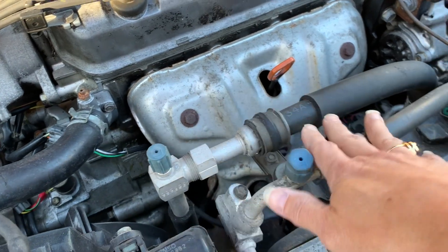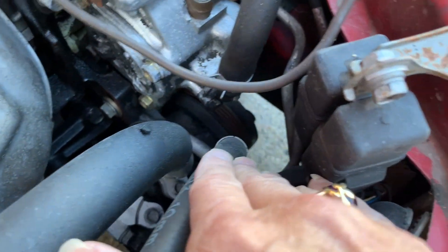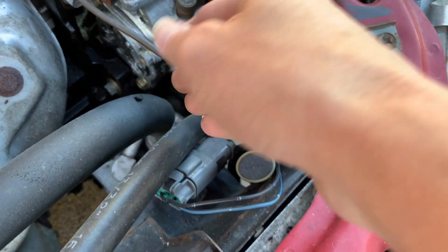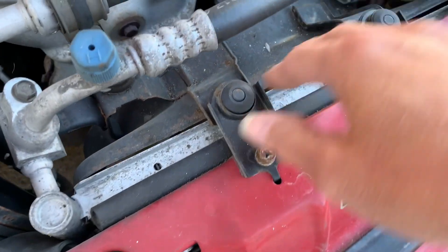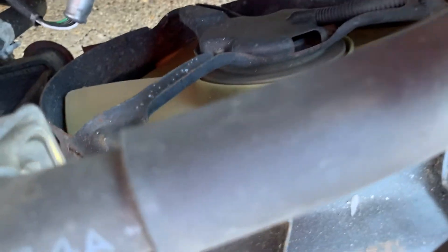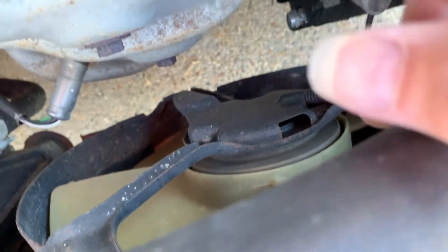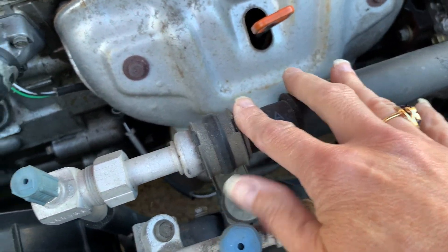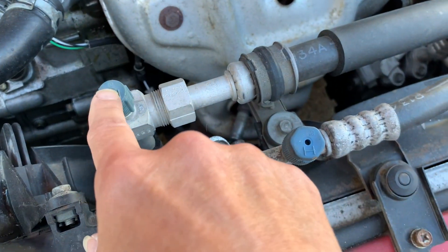These hoses here are for your air conditioner. Down here is the compressor where the hose is hooked to. All of this is the AC compressor. It has a belt that turns the compressor and pumps the R134A coolant through these tubes into the condenser. The condenser looks a lot like a radiator. And this is the condenser fan. There's a high and a low port — the high pressure is a smaller hose, low pressure is the larger hose. This is where you would add your R134A refrigerant if you needed to; you would add it to the low side.